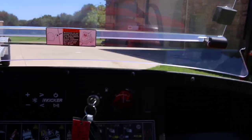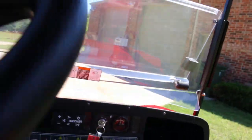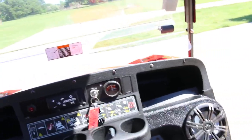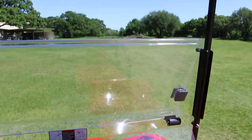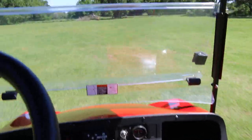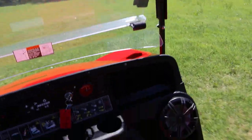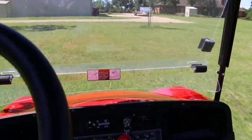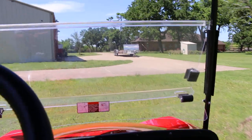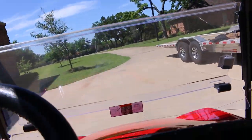It's got a fuel gauge right there showing a half a tank. Give it the gas — it's got a little power, it'll jump. We put fuel stabilizer in the gas because if it sits for a while the gas will start getting weak. We just fill up the tank and put a few ounces of Sta-Bil and she'll start and go whenever you're ready.